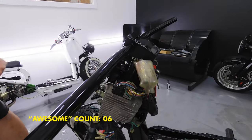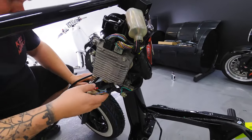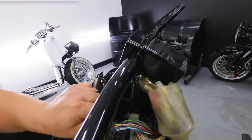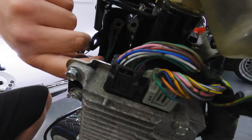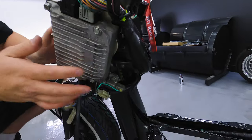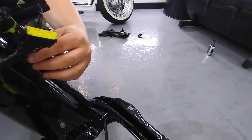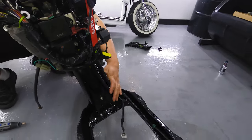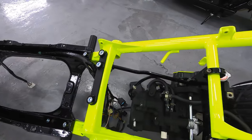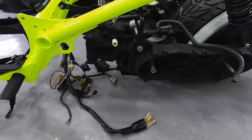Awesome. So just clean off a stud there, because we've got a big earthing strap. Oh, there, I've already got it in position. We've got this earth strap, which will fit nicely in there, making sure we've got a good ground for the ECU and all of this lot. It looks like you've been tidying up the loom as well. Yeah, loom's all been tidied. Obviously, we're going to shield it where we can. Started wrapping that as well because there was some suspicious wiring in there that I've tidied up.